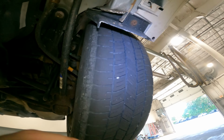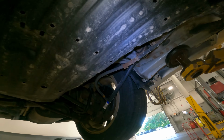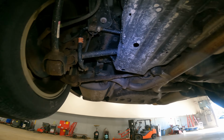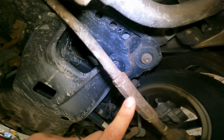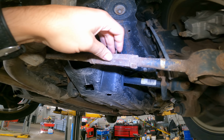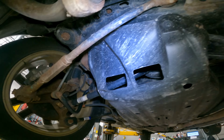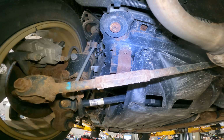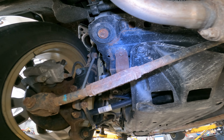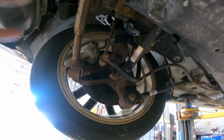Rear tires, yep. We got abnormal wear happening on the inside and outside edges. So we're going to recommend 4 tires and an alignment. Although, I am a little worried. That guy looks like it hasn't moved in a while. This one looks worse. Let me change the lighting. Maybe the lighting will help you guys. Oh yeah. No, we'll leave it off. Yeah. Look at that. That's bad.